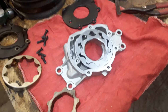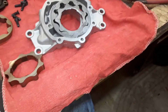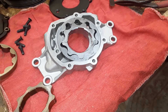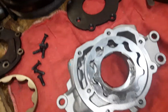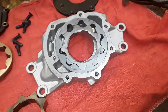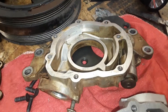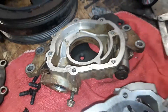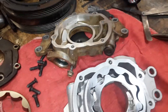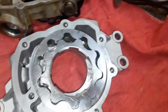We're dealing with a General Motors 5.3 pump — same as a 4.8, 6.0, and various other GM Vortec engines, like a small block Chevy with aluminum heads and a cast-iron block. The old original pump didn't exactly fail, but something went wrong with it — might have been the pressure regulator, because there's some chuckling in that valve inside the housing. I'm not going to mess with it.